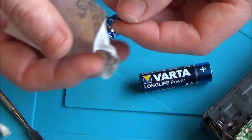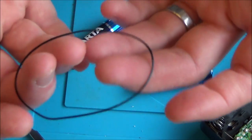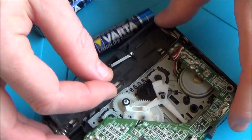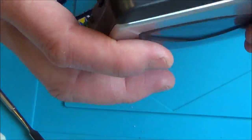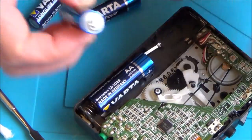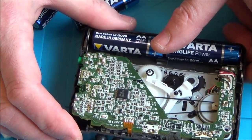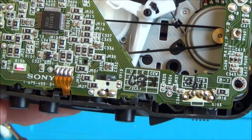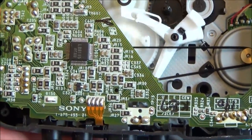I'm going to give the belt a wash. That's nice and clean now — the grease would make it slip. Let's try to get it back in without getting grease everywhere. It looks to be back in. Excellent — straight away it works. I think we can safely say the auto-stop now works. Nice little feature and a nice mechanism to do it — exactly the same as just hitting stop yourself.